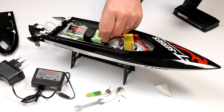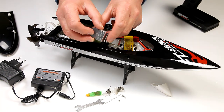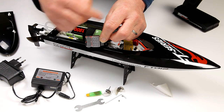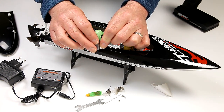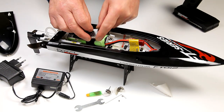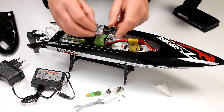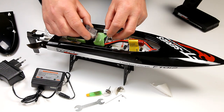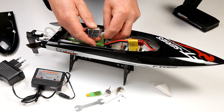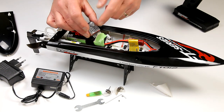I also put a battery alarm in here — a little one like this. I've done a full review on these and I'll put a link in the description. It monitors the battery and you set a level that you want it to alarm at. When I first did it I didn't seal it in a bag, and water got in and it was saying one of the cells was completely dead — but it wasn't. Dried it out in the airing cupboard and it was fine. Now I plug it in, put it in a little plastic bag with an elastic band around the cables, so it doesn't get wet at all.